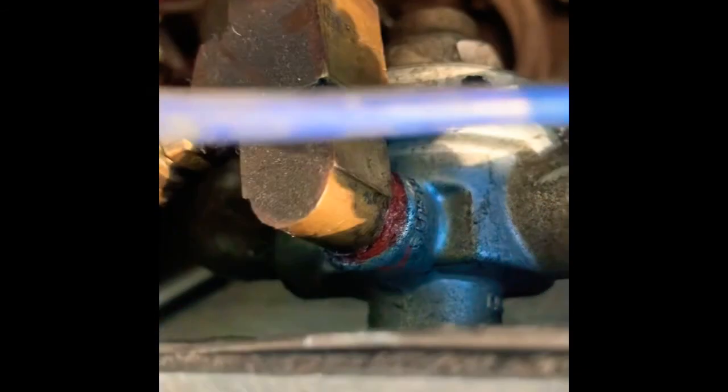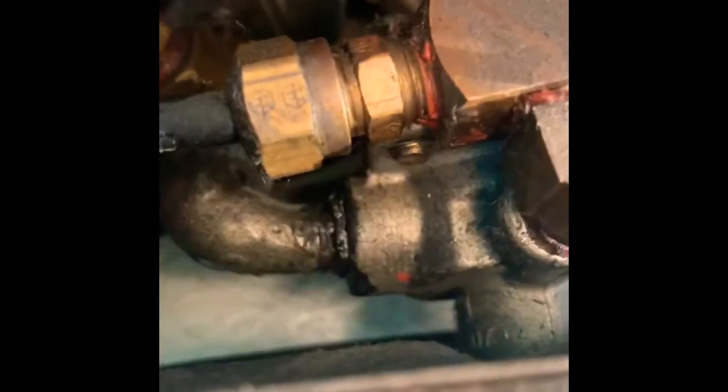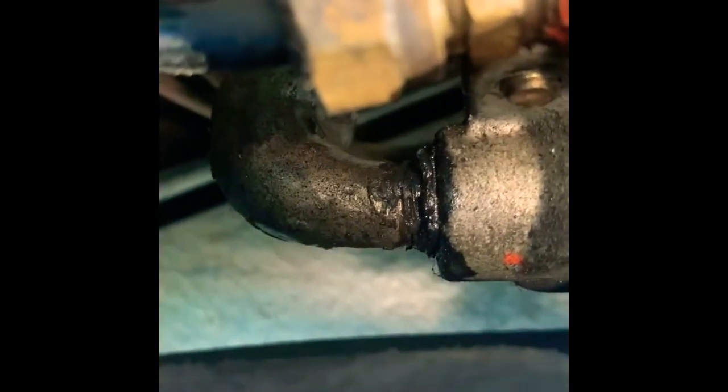What I'm gonna do here, as you can see, this top port has a supply on it. That needs to get teed into your supply on your new tractor valve. These are delivery valves on either side of this one. You can see they got some stuff going on here to cap this. I'm gonna pull that whole thing off and just put the right size cap on it to get rid of all that, and then I'm gonna put my trailer valve right there.